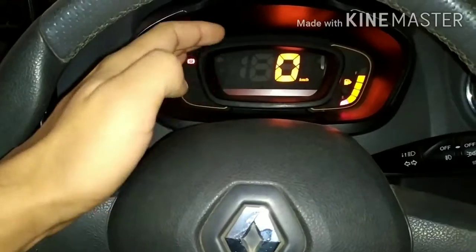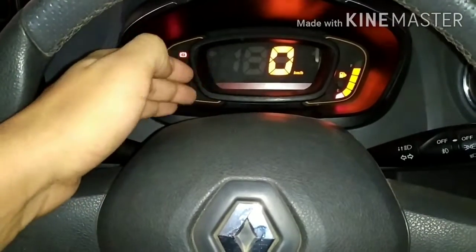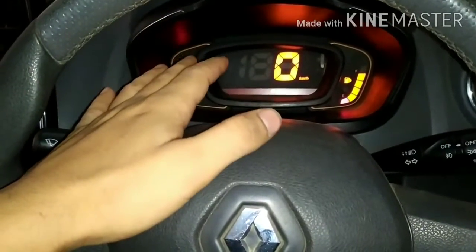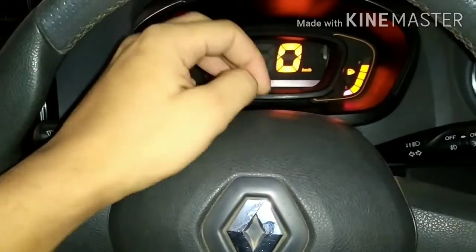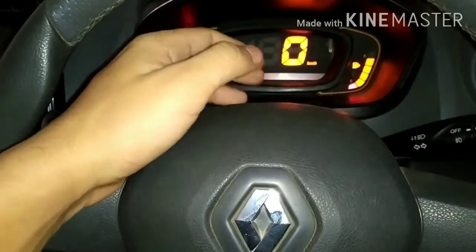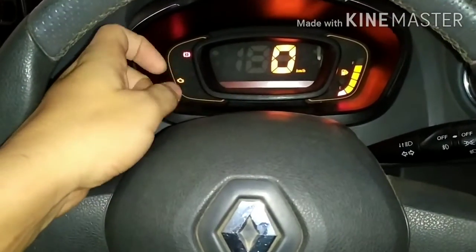Now we are talking about the oil pressure light. You have to check the engine oil — if the engine oil is not right or is low, it will light up. Because if engine oil is low, the pressure will not build up. The other thing is the oil pressure sensor or switch — it could be faulty. But the chances of it being faulty are not very high. Another reason is the earthing from the engine block — the negative connection, the earthing. Also the spark plug earthing is from the engine block. So one reason is that earth connection is missing — meaning there is no ground connection.